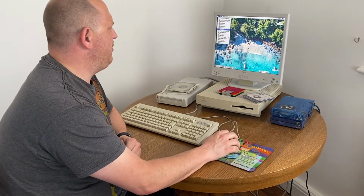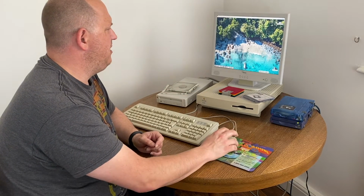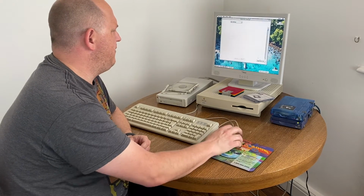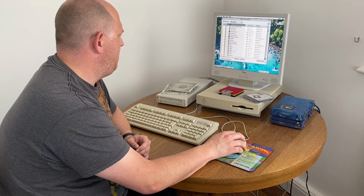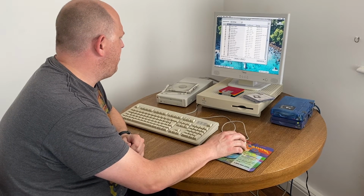But I have been playing with some extensions because if I don't have the Ethernet cable connected to the LC, you get the wallpaper loads, but the hard drive icons and the control strip don't load, and it sits there for about a minute and a half. So I was fiddling. I've obviously turned something off that I need. Actually, I need that one. Let's just have a quick look through the extensions, see if I can figure out what I've broken.